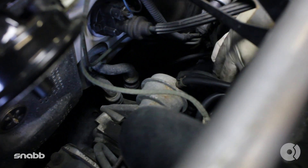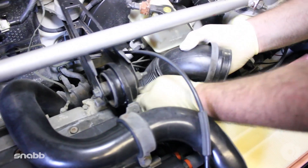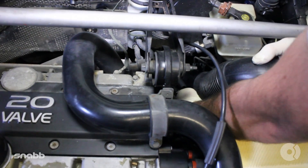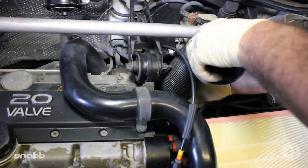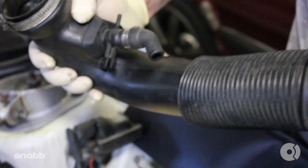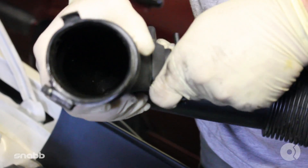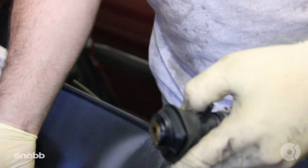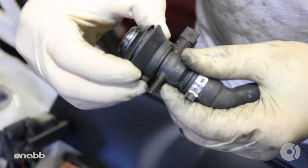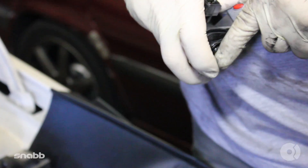Once you remove that, you can pull that off the turbo. Remove all the vacuum lines associated with your PTC as well as the electrical connection. Pull that piece straight out. Next step is fairly easy — what you want to do is pull the preheater or the PTC out of the intake. The twisting motion usually works pretty well. What you're left with is this odd-shaped grommet.